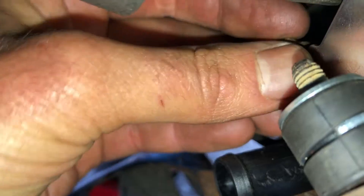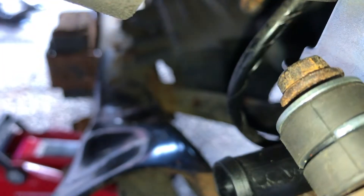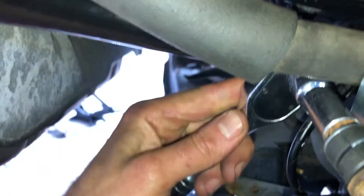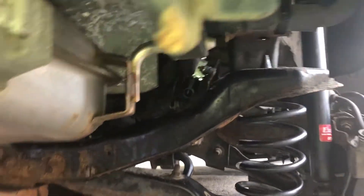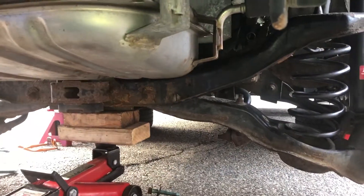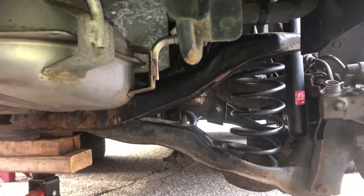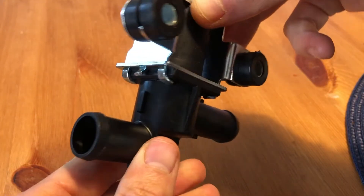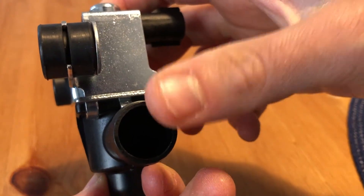We'll carefully put on our 10 millimeter nuts. These don't have to be super tight — just torque them flush and hand tight, because again these will rust. Raising the frame — there's a rubber grommet that looks like a cone, it's going to help align the frame back in. It's going to be super tight. Perform all steps in reverse and tighten all bolts with a torque wrench to the torques in the description below.